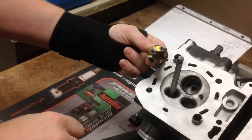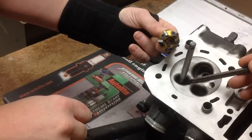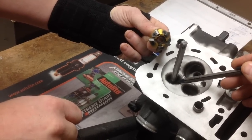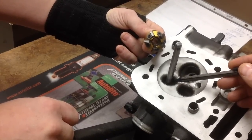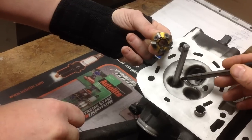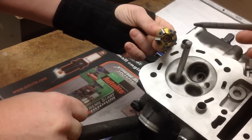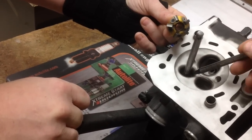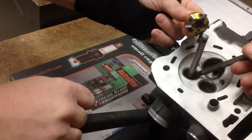The next step for Ross is selecting the 45-degree cutter. These seats are really quite good. There's about 7,500 miles on this particular motor. They are slightly wider than the Honda service spec, so we're going to be narrowizing these valve seats. But before we narrowize them, he's going to just touch them up to clean up those valve seats. Notice the bit on the cutter — we're going to pay close attention to where that is as he slides it down the pilot to make sure that the cutter is straddling the seat.